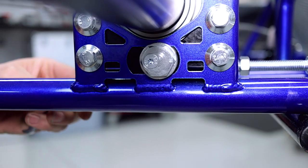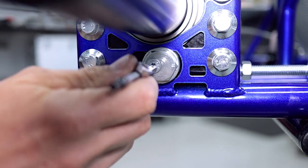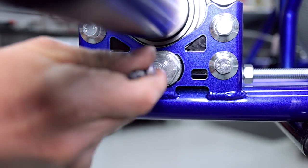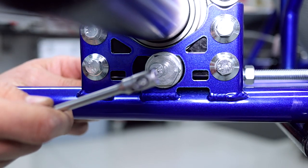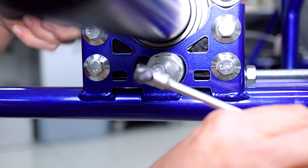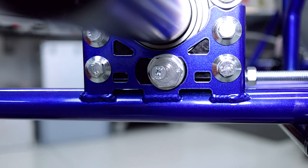So for the purpose of the video, we have removed the hub and the sprocket carrier so you can see, but you don't have to do that. If you just move the sprocket carrier out of the way, you can get your Allen key into the locking screw, and there's a 10 millimeter ring spanner on the other side, and we can just loosen that off. And then if we do that on both sides,